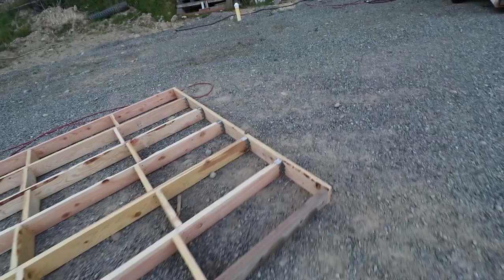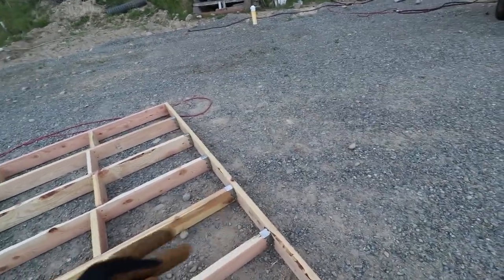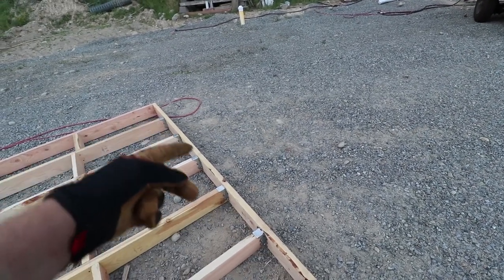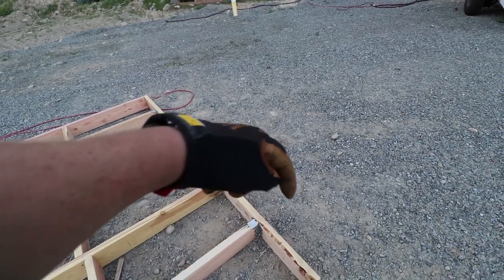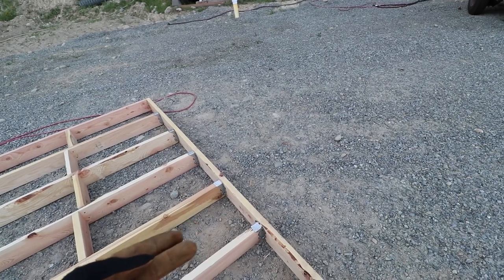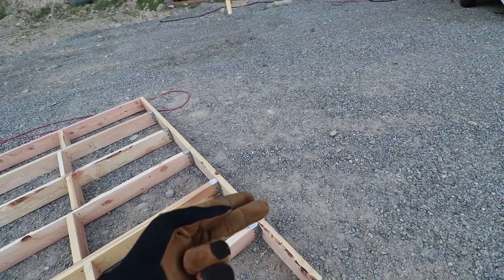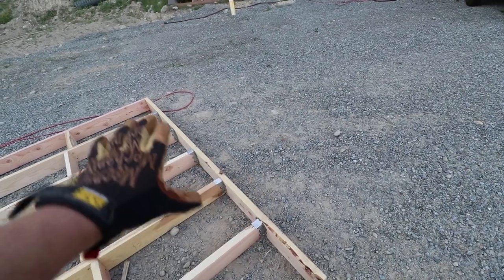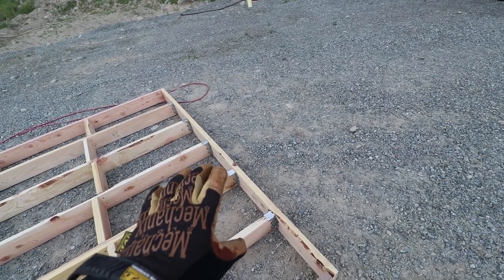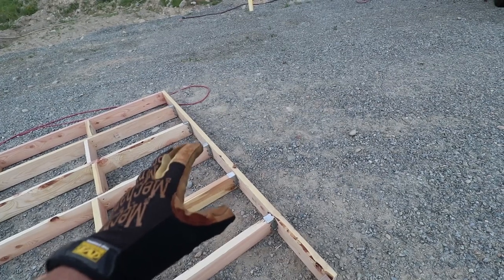But I've been thinking about this, and one of the weaknesses of our current Grizzly is that all that holds this rim joist on this rim board is screws that come in from this side. So it's the threads. And of course, as all that rock hits the bottom of this board, it pops that board off. On top of that, all the rock that usually accumulates here on the bottom, I'm gonna stop and say this because I know somebody's gonna comment: this is upside down, folks. This will be rotated over so the hangers are oriented correctly.